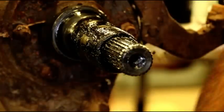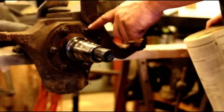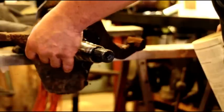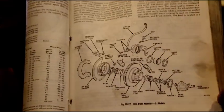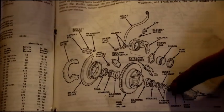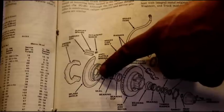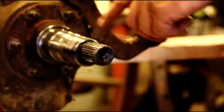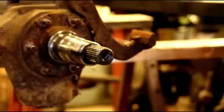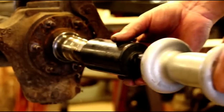There's your washer and your outer bearing, and the inner bearing is in there with a seal. I'll show you all that as I put it together. I've got the nuts off that hold the spindle on. These little remnants right here are all that's left of the shield that's supposed to be in there. So far we've taken off the hub, wheel bearings, and the rotor. Here's your inner bearing — now there's supposed to be a dust shield right there, but it's completely rotted away and missing. So I'm going to have to find another one of those.